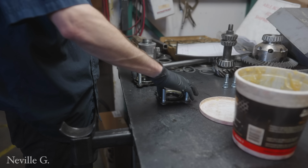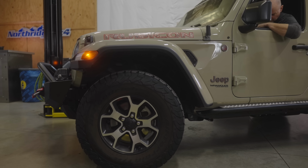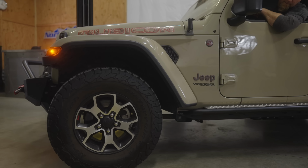So for these, I think that it's doable with someone that has a really nice light foot. With the diesel torque, with how many speeds you have with the low gears, you can break a 1-ton shaft too on a 40. But with nice light driving, knowing when you can give it that wheel speed or when you need to back off because you're bound up, that is the key between breaking an axle and not breaking an axle.